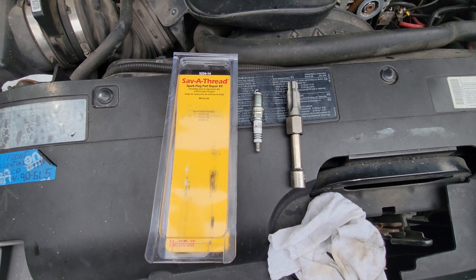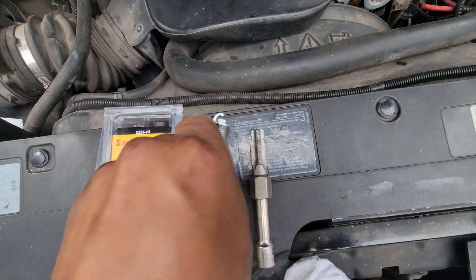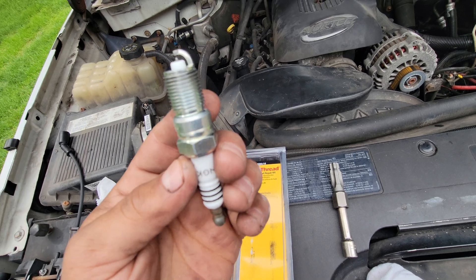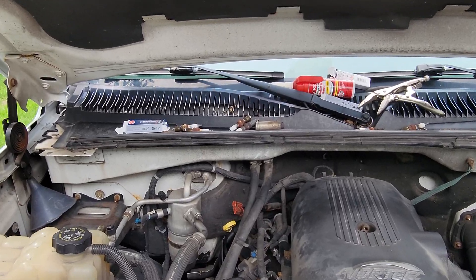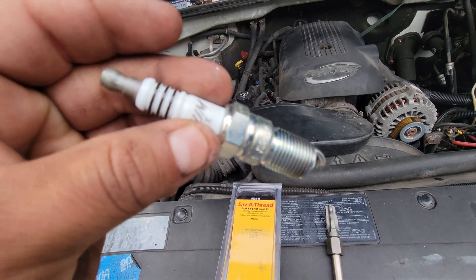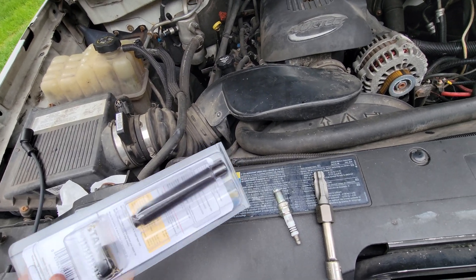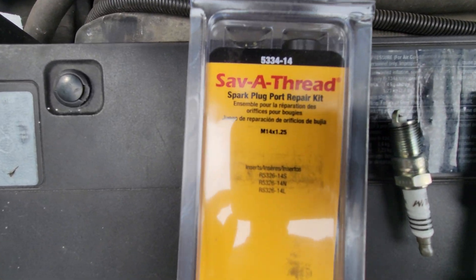I have a 2004 Chevy Silverado 2500 HD. The thread of the spark plug is 14 millimeter 1.25. I got a misfire and the spark plug was shaking — the old one. When I tried to put the new one in, I realized I was not able to get it tightened. So I went to O'Reilly and AutoZone, but they don't have good thread repair. They have the Stanley kit, and this is the one you want — find the part number.